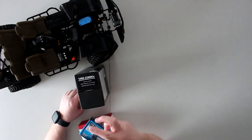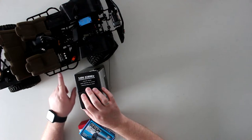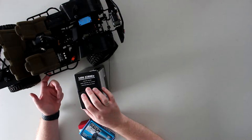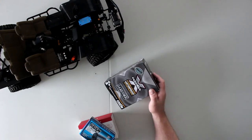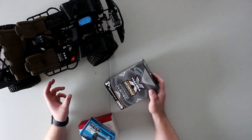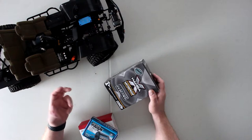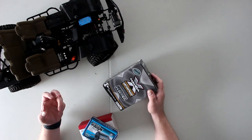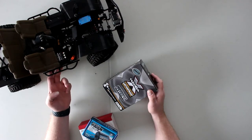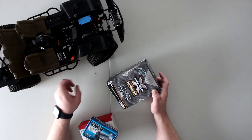This is a 2280 kV motor designed for crawling. I'm running this machine on 2S — I could run it on 3S but I don't see the need personally. On a 3S brushless system you gain more torque, and even on a brush motor you gain more torque, but that also means overheating your motor and creating more heat on your speed control. Right now I can run this machine on a 5000mAh 2S 50C pack for three hours before I kill that battery, then swap to my second one.